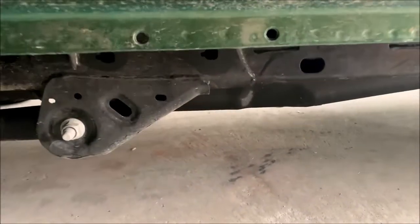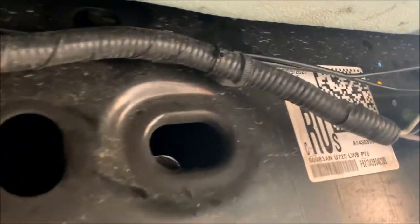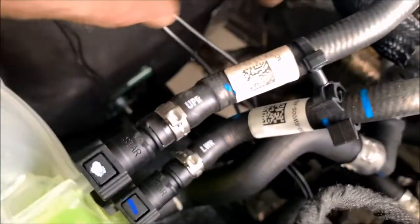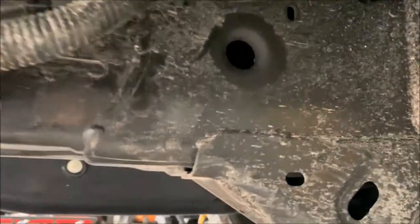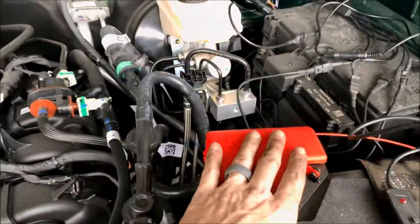Just finished running all of the wiring — I did it all off camera, just a matter of zip tying it along the way with that existing wiring harness. Here's the passenger side: I zip tied it on the frame rail right here, then tied it into that wiring harness at the top, and just zip tied it along the way. I went over the top of this right here just like I did in the rear. From the engine bay, I have them coming from the bottom straight up to the top. I've got my two from the front coming over and joined at the top with a zip tie. Driver side is the same — zip tied along the whole wiring harness all the way to the front. It does take a little while to fish it around the front part into the engine bay.